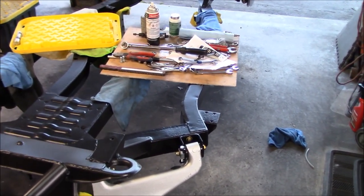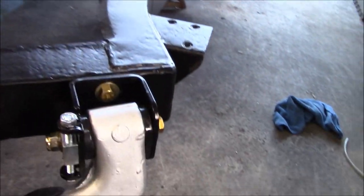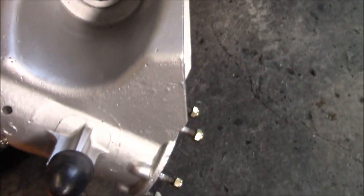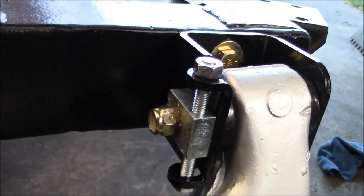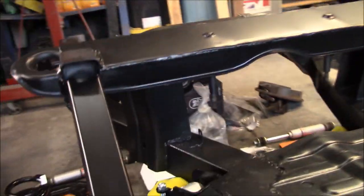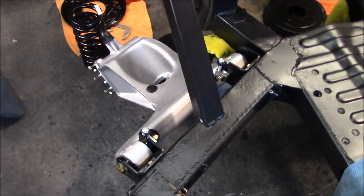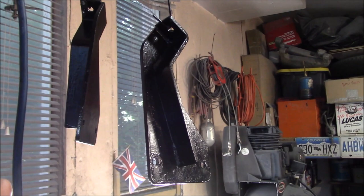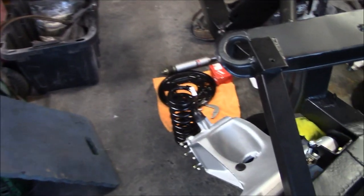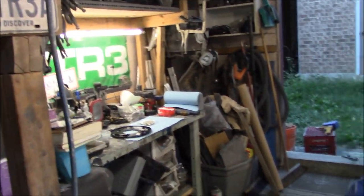Just coming up to 8 p.m. - I was stopped mid-tutorial on the trailing arm brackets as my memory card ran out. Had to go inside and download the camera. Here is what the finished brackets look like on the trailing arm: the inside one low as far as it can go, the outer one about medium right in the middle, with nylocks and washers on the inside on the frame rail. Both driver's side and passenger side are installed. We're going to paint the tube shock brackets - we've sandblasted them - so it'll take a while for that to dry.